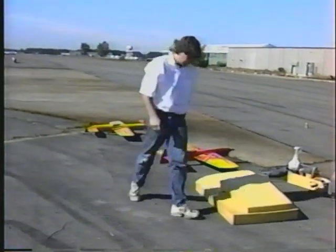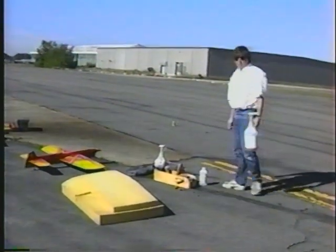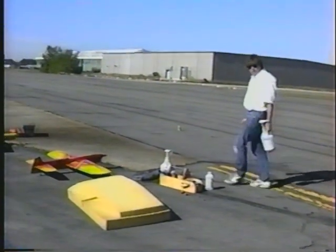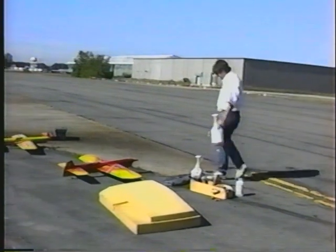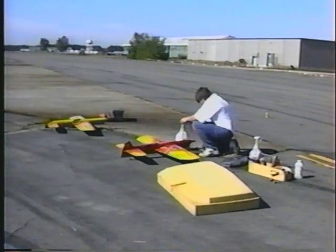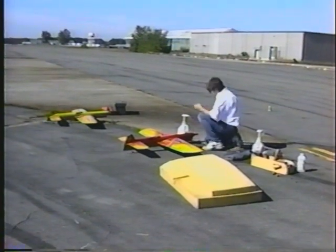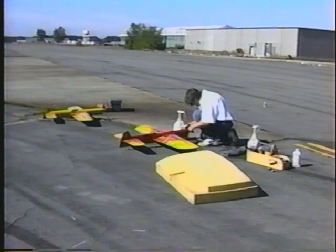All right, are we ready to fly this? Or do you want to run it once with the 5%? Do we want to eliminate the detonation first, or see if we can? I want to put the 5% in and run it once. That's still detonating. We're still getting that rattly noise in there. I don't really like it. I'd like to get that sorted out before we fly.